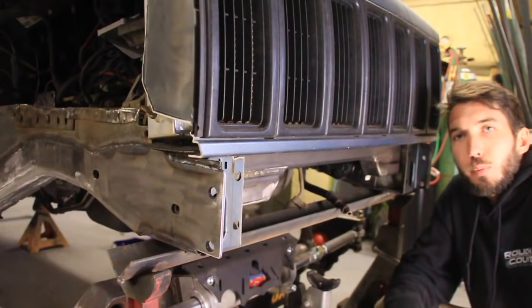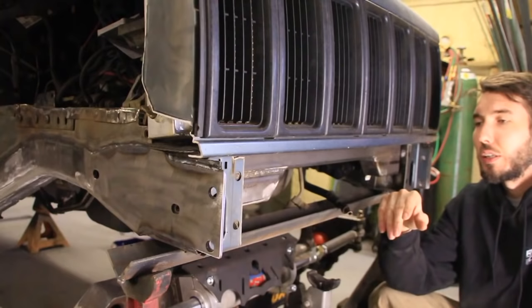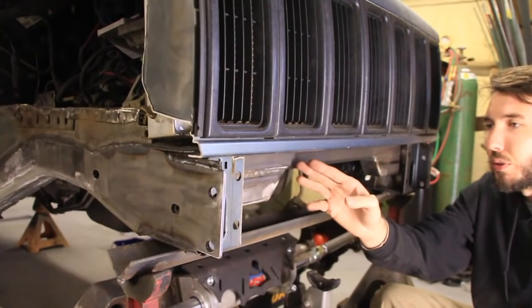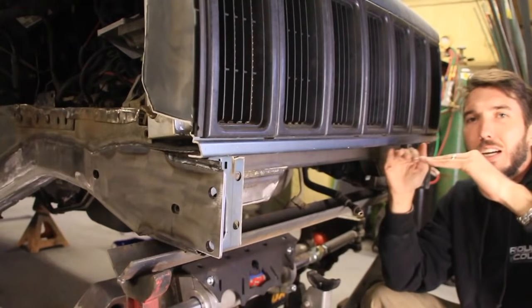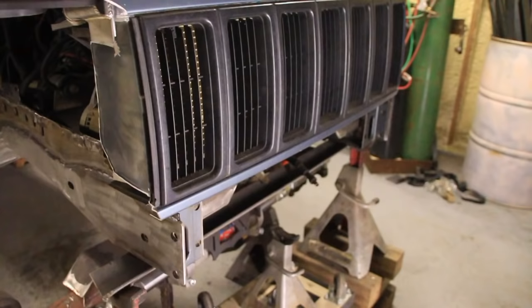So this is the front of the Scorpion Crawler project I'm working on. You can see we've already strengthened the frame up here. One of the important factors is the ground clearance on this thing. I've cut out the stock section that sits here — it usually swoops down like this, made out of sheet metal — and I put in this 2x2 bracing with some pieces on the end. I've got it up a lot higher. Now I want to do the same thing with the bumper to keep it out of the way as possible.